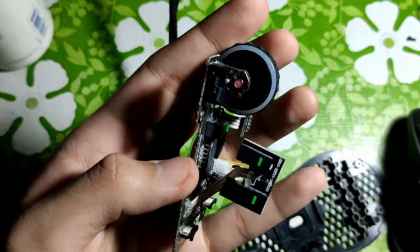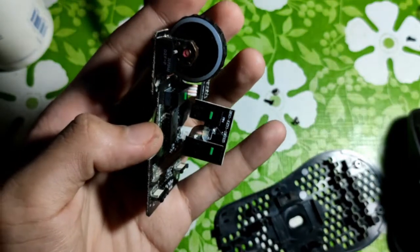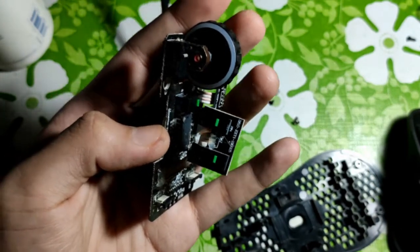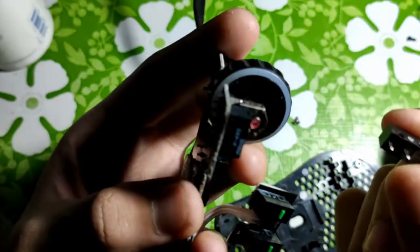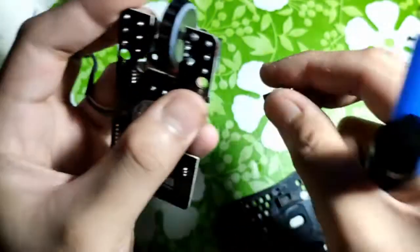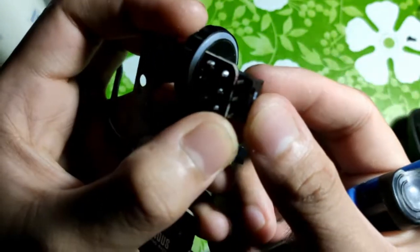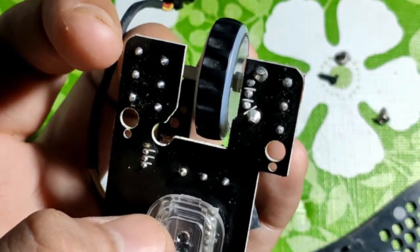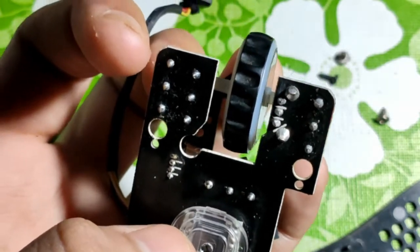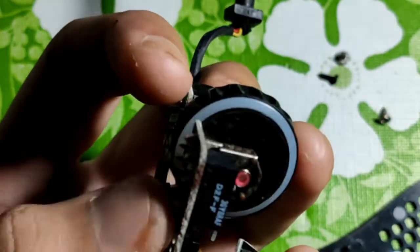Now for the actual soldering, just use a temperature controlled iron like the TS100 I got here, and set it to about, let's say, 350 degrees, and use a solder pump to remove the solder from the switches to remove the switch. Then when you plop in a new switch, remember that when you solder it in, let it cool down first after soldering one pin. Also use low temperature melting solder like 60/40 leaded solder, as you don't want to stress the switch when you are soldering it onto the board, because it will really mess up the actuation force.